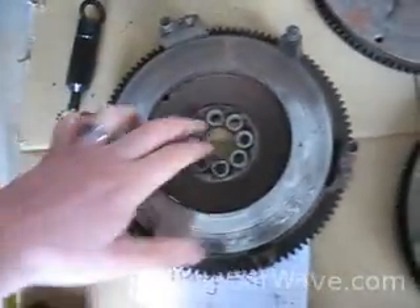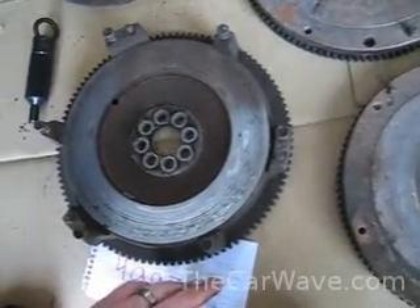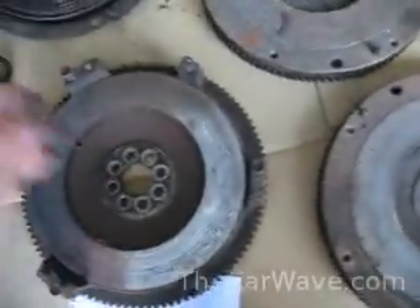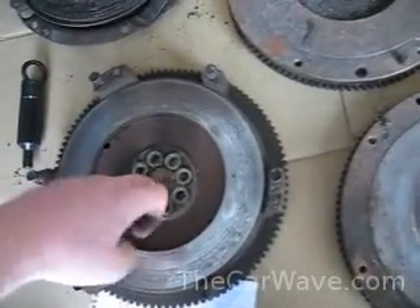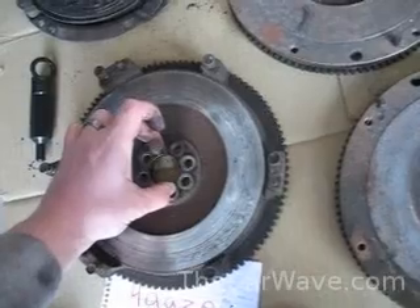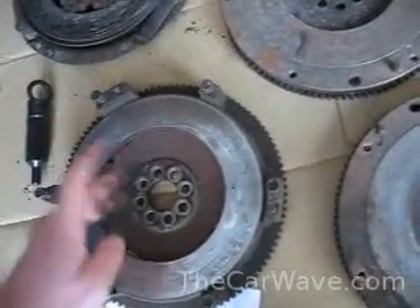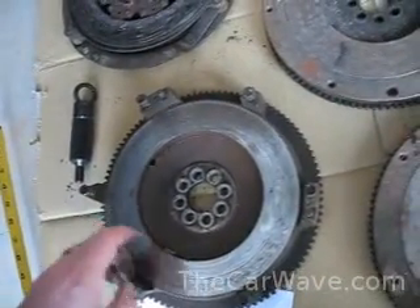The center circle measures 35.5mm — I measured 36 and 35.6 over there, so pretty similar. This is basically the concentric mating surface to the flywheel. The bolt hole is the same, so if you match the transmission with this flywheel clutch assembly, you can swap this onto the non-supercharged engine and it matches — everything mates up fine.